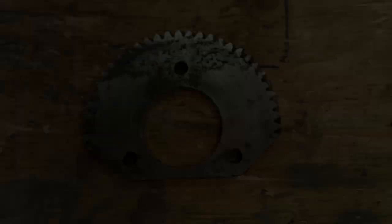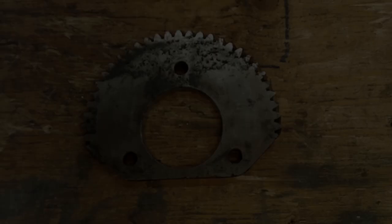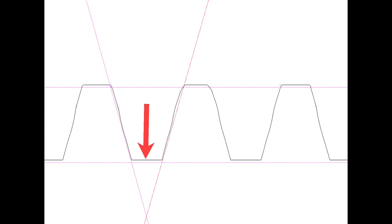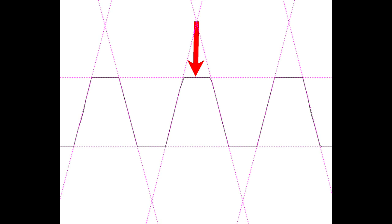What I'm going to do now is try very briefly to explain how I cleaned up the gear faces. I'll show you the quadrant again - after all, they do mesh together, and the quadrant is much easier to explain than the worm gear. If I straighten out the gear teeth, we'll have a rack. The teeth, instead of having a correct profile, will on the most worn central teeth have a worn profile. I'm planning to use a grinder to lightly recover the tooth profile by cutting deeper into the material with a 12dp profile, then skim the top to maintain the overall tooth depth on both parts. After this is done, both the worm and sector will mesh together much better than before.